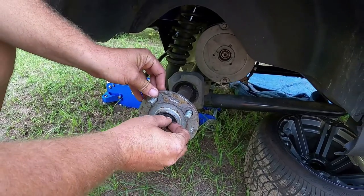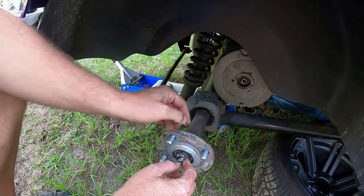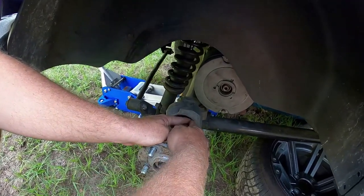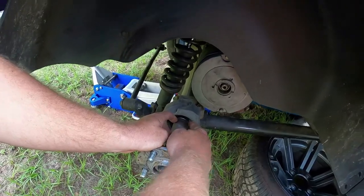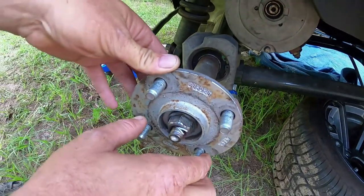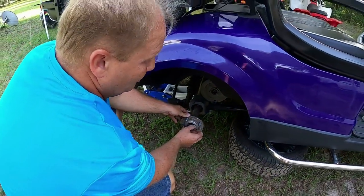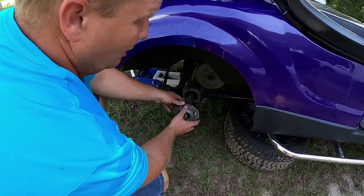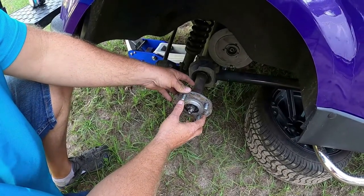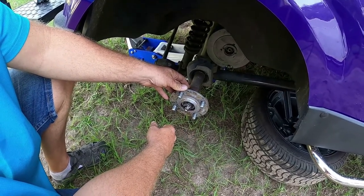You can also see this play. So what we have to do here — just to give you a heads up — we're going to take this pin out because it's easier. There's a snap ring right back there that I'm going to remove, and I'm going to put my slide hammer puller in here and pull out the whole axle and bearing as one assembly. Then we'll undo this nut here, take this hub off, take the axle to the press, press off the old bearing, press on the new bearing, and reinstall everything.